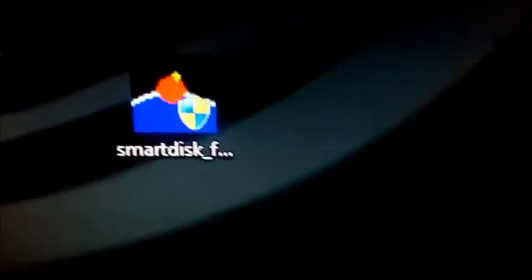So exFAT — for some reason the camera doesn't work with it at 64 gigs. What you need to do is download this little program; just Google it and you'll find it. It's called Smart Disk FAT32 dot EXE. Run the program, find your SD card — already showing here as the only one — click 'Format Drive', confirm that all data will be deleted, click yes, and just let that process go. It's pretty quick depending on your SD card.